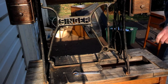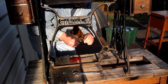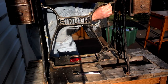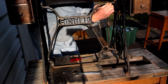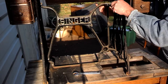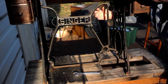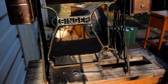To start, I'm going to do this from the rear coming in. We take our guide like this and the screw goes through to the back — you just screw it in. You don't really want to tighten this up until you put your flywheel on with your cord, because you want to line it up. It actually kind of swivels around, and you want it adjusted so the cord goes through without rubbing on the sides.